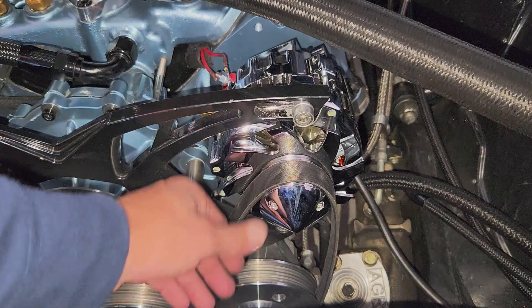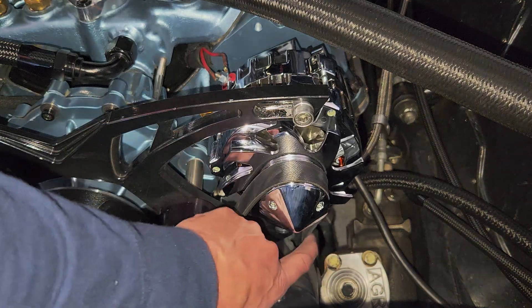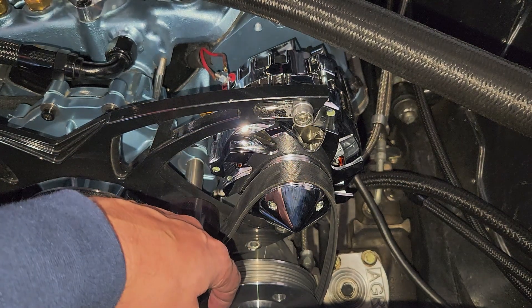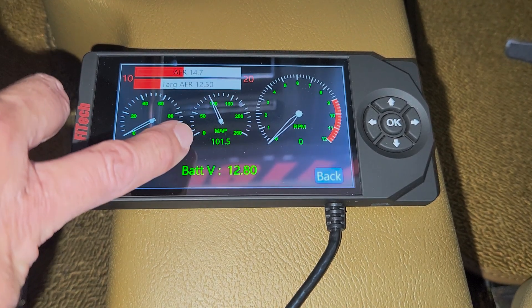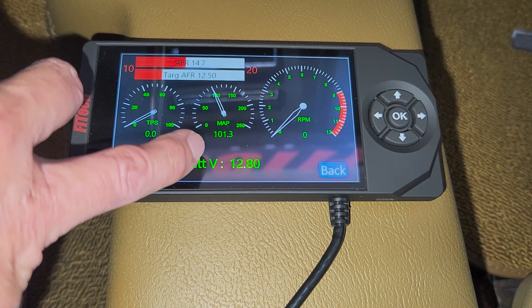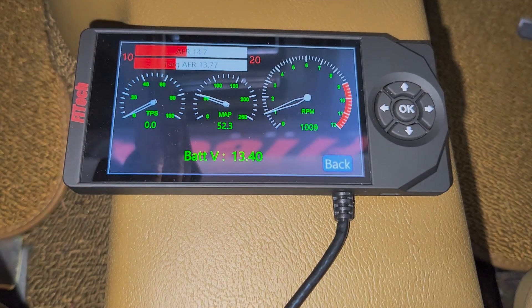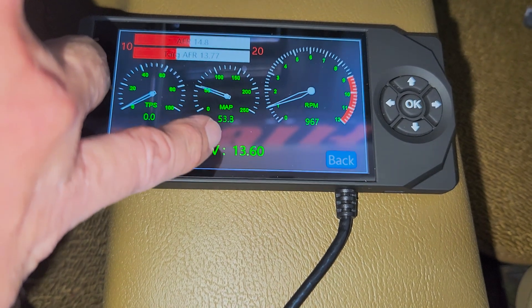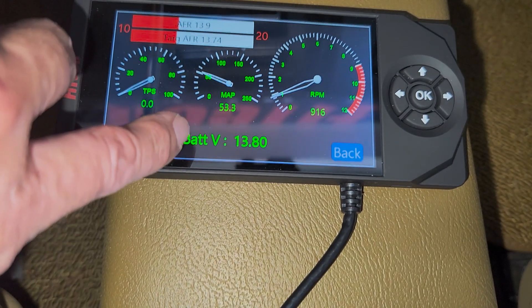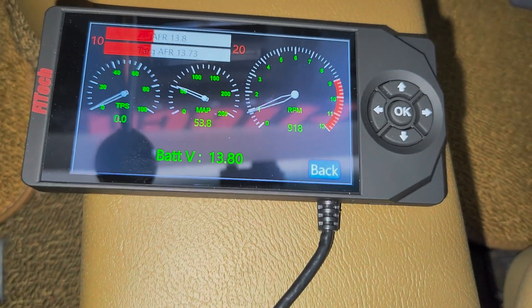I'm going to throw this in and see if that belt's long enough. We're back in, and as I guessed, this is as far as tight as I can go with the alternator and the belt's way too loose. However, being daring, I think at idle we might be okay. I'm going to just idle it before I take that alternator off and change pulleys. So we're at 12.8 resting. Let's crank it up — remember before it dropped to 11. Oh yes, much better. It's not in the 14s, but that is way better than the previous 11. I think the regulator kicked in and started putting more juice out. Touched 14 right there.